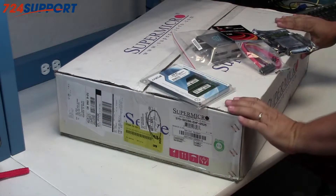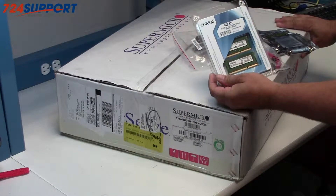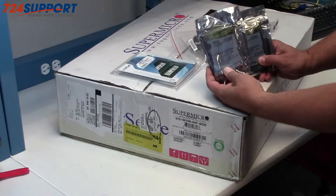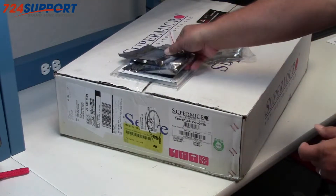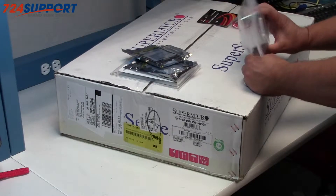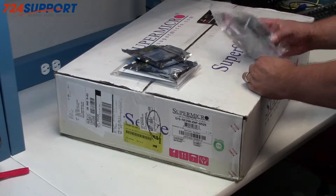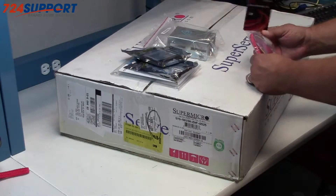Today we're going to include, in addition to the Atom Server, 4GB of SO-DIMM memory from Crucial, two Western Digital 320GB black 2.5-inch disks, a Supermicro 2.5-inch double bracket for holding them in a 3.5-inch slot. These, by the way, in addition to fitting well in a Supermicro Server, are also cheaper than the aftermarket version, and an additional SATA power combo cable.